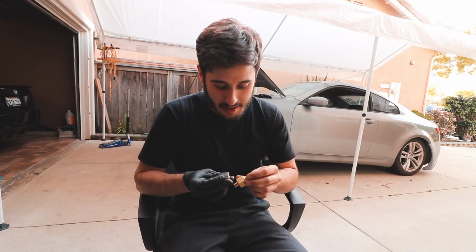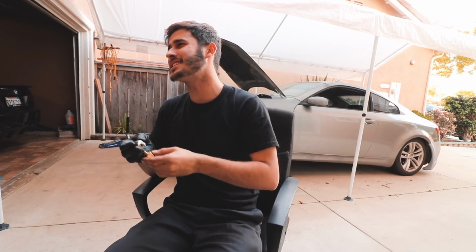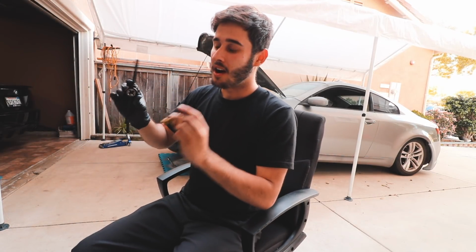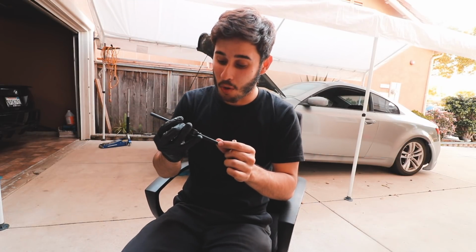All of the sensors are done. It does look roughly the same size. So when I was threading it in, it did get hard. And Chavez thought of an amazing idea to finally use our tap and die set. So the actual threading of this connector is a 1/8. Obviously, I don't recommend getting this connector and doing all of this work. You don't need to. So make sure when you do order an oil pressure sensor for this car, order the one with the 1/8 threading.